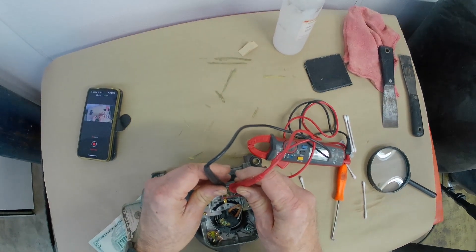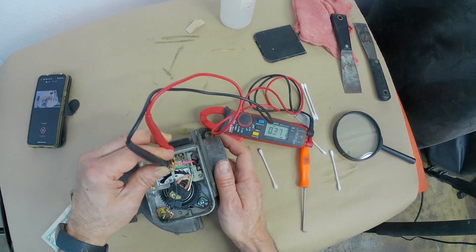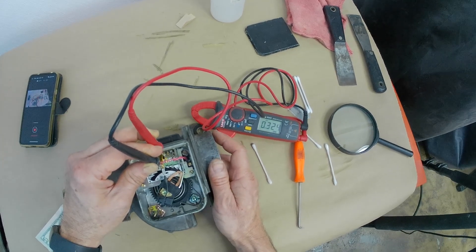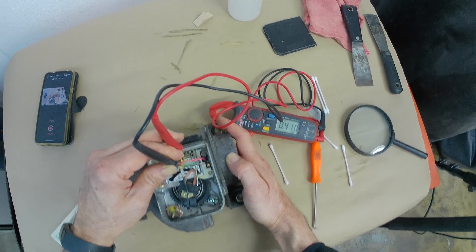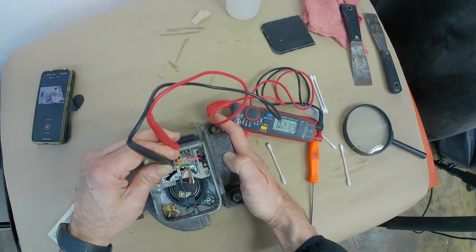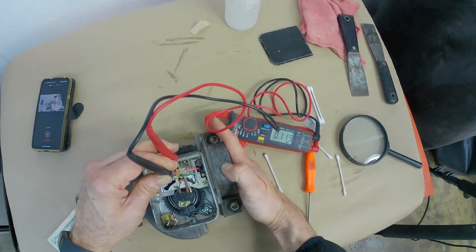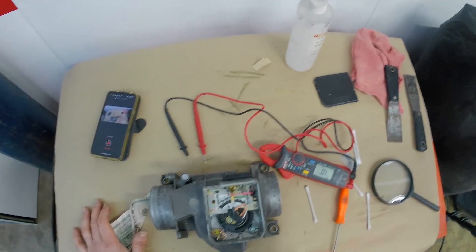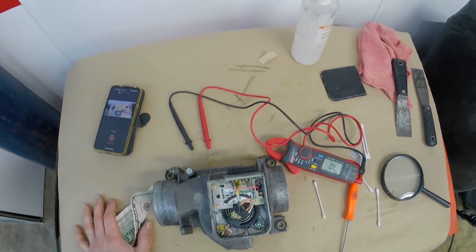This time I've zeroed the meter so it's not on auto range. The meter is stuck on kilo-ohms — before it was on auto-ranging, which can cause some reading problems. At idle or door closed it's 0.08 kilo-ohms. The maximum in this segment is about 0.4 kilo-ohms, and then it goes down to practically zero — a little bit negative right between the segments, then it ramps up again. I'm not getting that erratic behavior anymore. It looks like it's improved — cleaner, with no more traces or witness marks on that black ceramic piece.